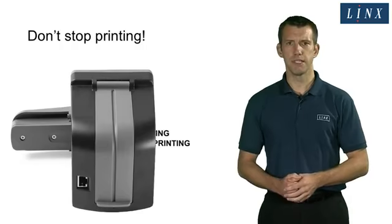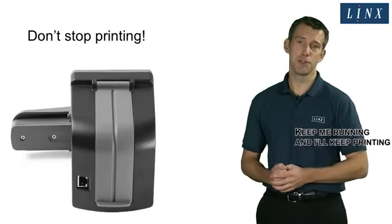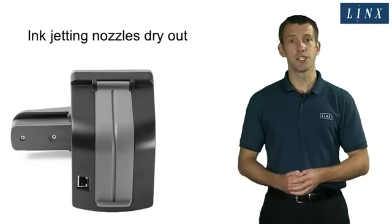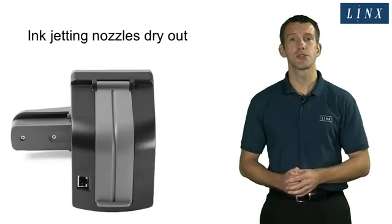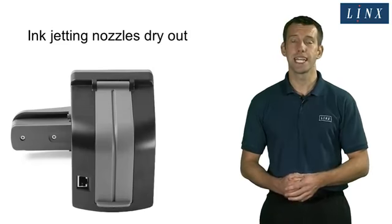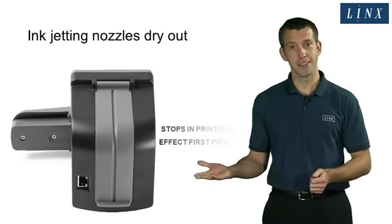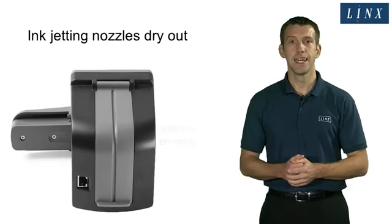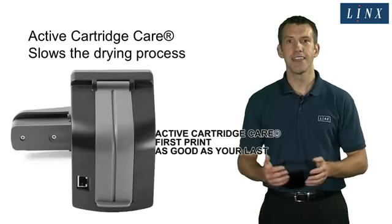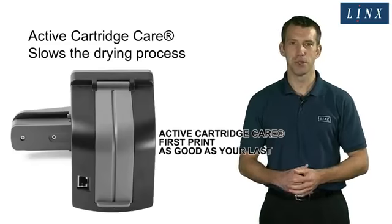Other thermal inkjet printers can be reliable, as long as that is, you don't stop printing for too long. When you stop printing with a thermal inkjet printer, the ink in the printing nozzle starts to dry. If you wait too long or your ink is particularly fast drying, then you may be familiar with the message problems like this. Active cartridge care maintains the cartridge in conditions that keep it ready to print, so your first print can be as good as the last one.